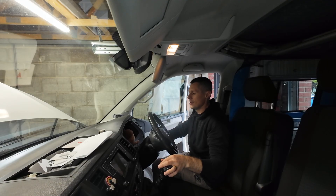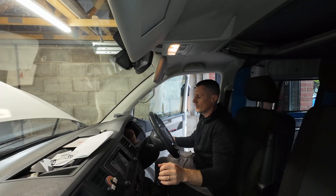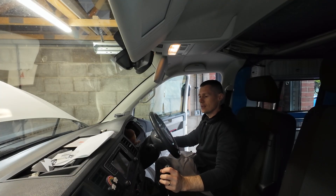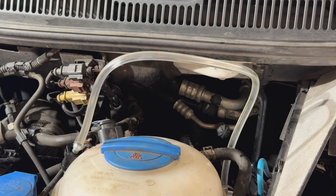So this is key in — ignition on. No fuel pumping through the pipe. Key off, key out. We'll try it a few more times to see if anything happens. Key in again, ignition fully on. Still no fuel pumping through the pipe.